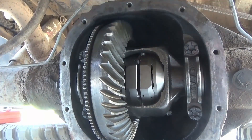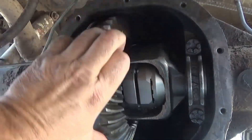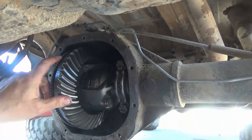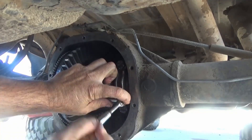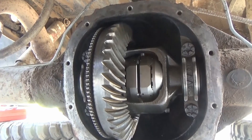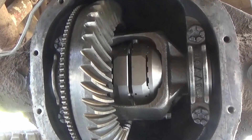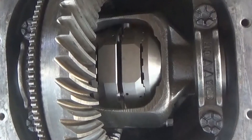Here I'm moving the couplings back and forth to show how the gears compress and slip past each other when you're turning a tight circle on asphalt. This is a beautiful kit — the workmanship is fantastic and everything fits together beautifully. The only issue I had was that the instruction manual didn't seem to go with the kit. Here you can see me tightening up the center pin retaining bolt, which is almost the last step. Once that retaining bolt is tightened, you can put on your gasket and rear differential cover and you're completely done. This Spartan Locker — some people call them lunchbox lockers — is a little noisy when you turn sharp on asphalt, but the traction you get is fantastic. Thank you very much for joining me for this video — goodbye.